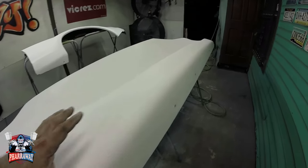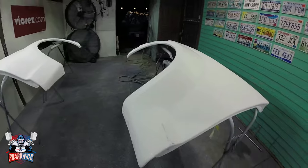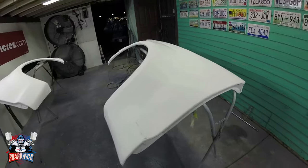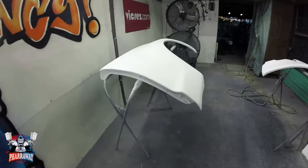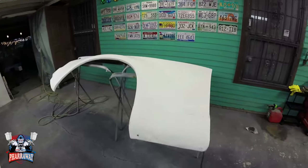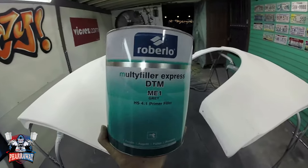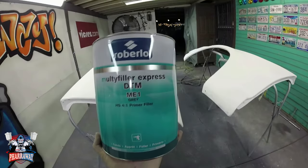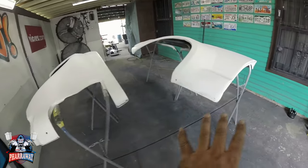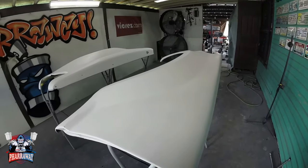After sanding with the 220, everything has been completed and everything is good. Now you've got to get yourself a real good high-build primer — it has to be a 2K high-build primer. Do not use 1K, it ain't going to work. If I sound funny, it's because I'm a little under the weather, but let's just finish it up. This is the primer I'm going to be using — a DTM primer filler. I'm going to apply three coats. This is four to one: four parts of the primer, one part of the activator. I have cleaned everything with a wax and grease remover. They're ready to go. Let's put the primer on the gun and start spraying.